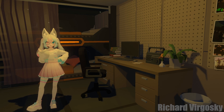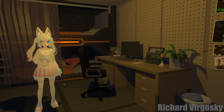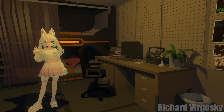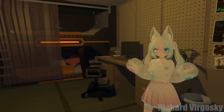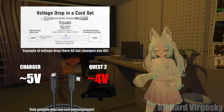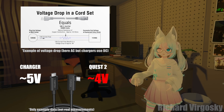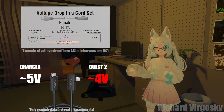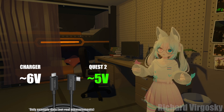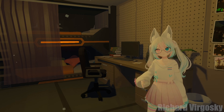Another important thing is our charger. As I mentioned before, Quest 2 does not support fast charging. But one particular feature of the Quick Charge protocol allows us to charge unsupported devices faster than regular chargers. In short, when using a long cable to charge a 5V device, the voltage at the end of the cable where the device is connected will actually be lower than 5V, and the reason for this is the voltage drop related to the resistance of the cable. To compensate for this lost voltage, Quick Charge uses a slightly higher voltage — let's say 6V — so we still have a clean 5V at the end of the cable to charge our device. Simple, right?